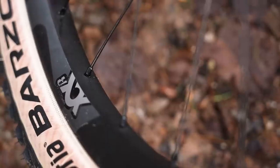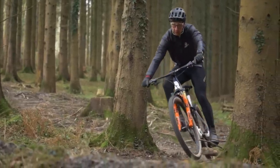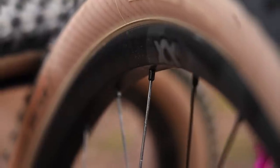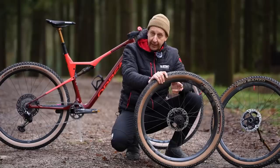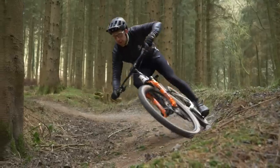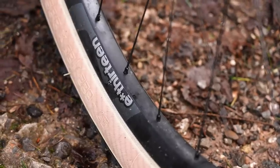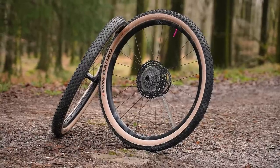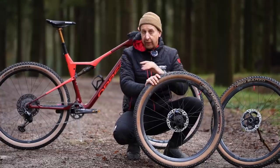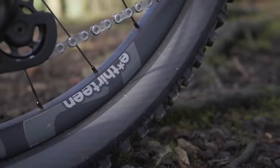These ones are also XCX Race, but they have a 28mm internal width versus the 24. This does a few things: the rim is stiffer, the rim is stronger, and it can support a larger volume tire. Unlike the 24s, the 28s also have triple butted spokes — DT spokes again, very high quality — meaning you have more material where you really need it near the rim and hub, and in the center of the spoke it has a little less material, so it's strong but also very light. Although the rims are bigger and stronger with 28 spokes front and rear, they're not really that much heavier — still only 1,520 grams for the pair, which is immensely light. They're suitable for cross country and can also delve into the trail world. I've run these on my reactor previously with trail tires and given them a really bad time, and they've been absolutely fine.